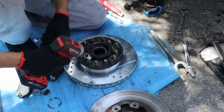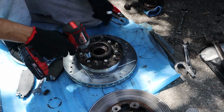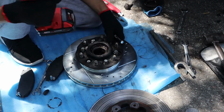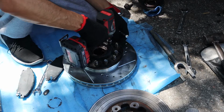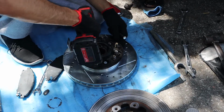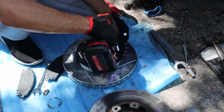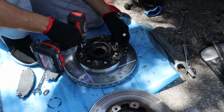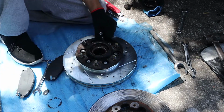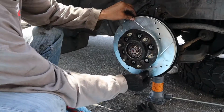Now it's time to screw back in the bolts. Do not screw it clockwise. Screw it like the opposite side, you know, like in a star shape. So that's how you make sure you're tightening the bolts evenly. Like so. Okay, so looks like we're pretty much done with the addition of the disc brake to the wheel hub. Give it some turns, make sure everything's tight, nothing's loose.